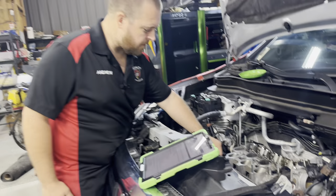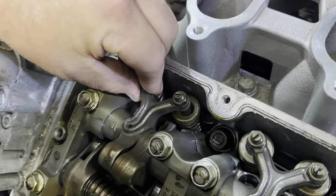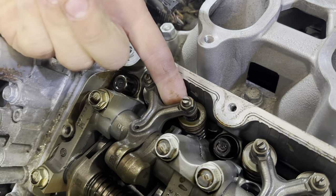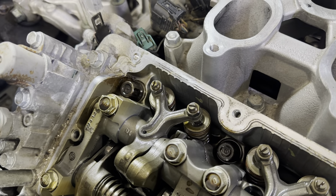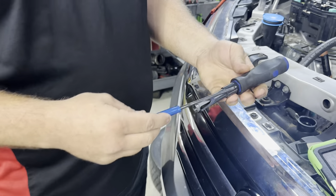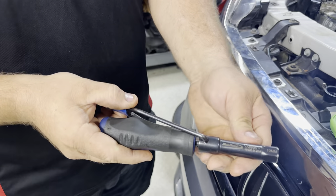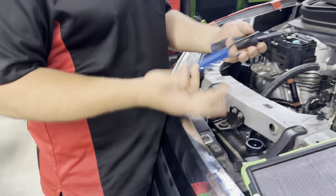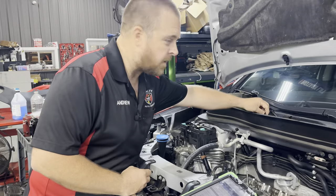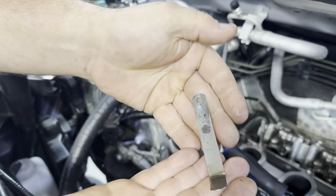If you want to look in here, we've got an adjuster screw and a nut. So you are basically adjusting that clearance between the base of that rocker and the top of that valve. You can do this with a wrench and a screwdriver. I happen to have this fancy tool here from Bluepoint, which comes in really handy — everything's in one spot. And then you've got your feeler gauges, of course, and that's how you check the actual gap.